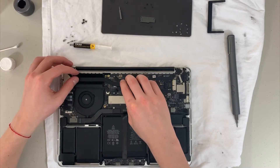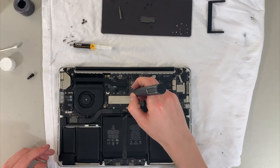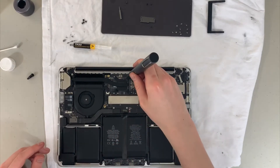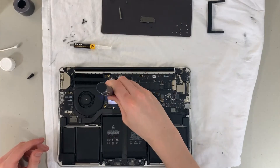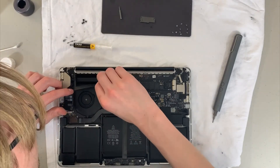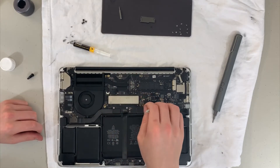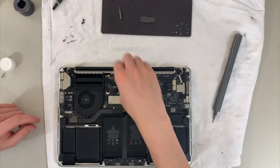Anyway it'll work — you'll just have some excess going around the edges. Take your heat sink, place it back gently, don't apply too much pressure, just kind of push it in a bit, make sure all the screws are aligned, and then put back all the screws and screw it back in — don't make it too tight. Ideally you'd do one screw in the heat sink on top of the CPU and then the fifth screw near the fan, alternating for even pressure. Put back the rubber guard. My fan wasn't that dusty, but if yours is, I'd recommend using a can of pressurized air to clean that area. Then just clean some more around the battery — some general excess dust.